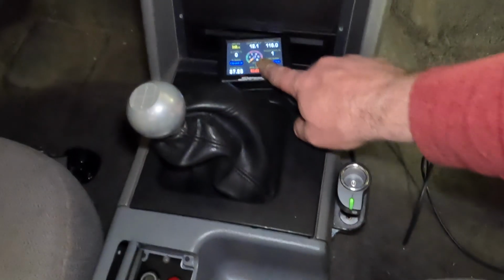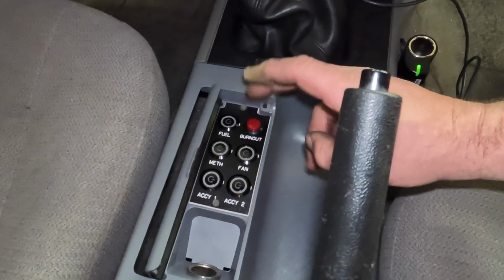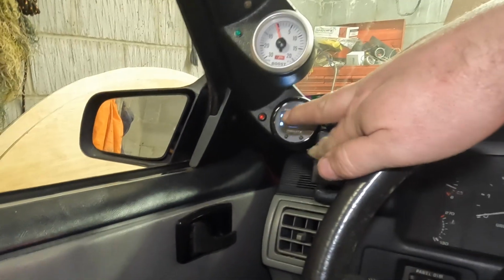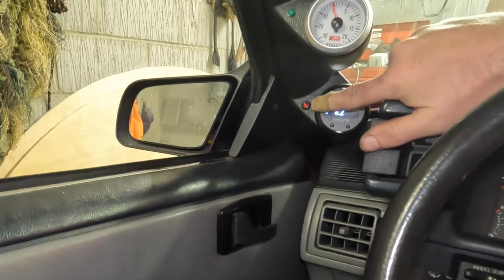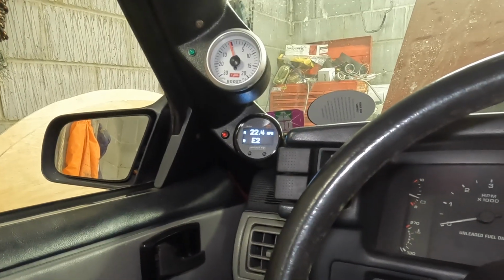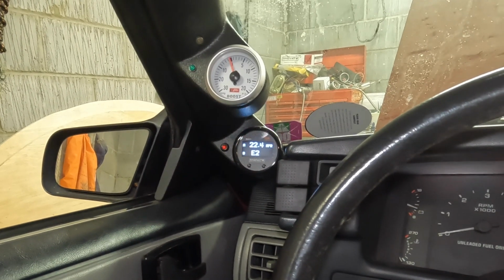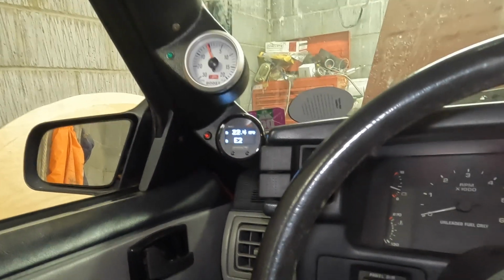So power's on from the Holley. It's all back together. So, burnout. This is for the line lock brake. So up on the A-pillar gauge, if you can see my band-aided finger, to the left of the AFR gauge is a little light. It has a flashing red LED, so when we hit the line lock button, there's a status indicator that we have power to it, and if you heard the click, you pushing the button, that works.